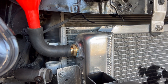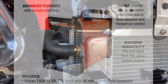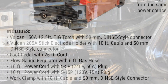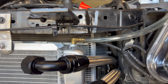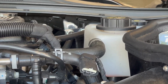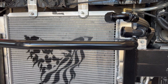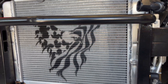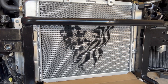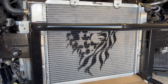It has a large three-quarter NPT inlet so that you can put AN fittings or whatever you want. It's got a vent on the top that's going to go up to my surge tank. It will tee in right there so that all the fluid coming out of the supercharger pulls any bubbles that could accumulate, making sure that 100% of this radiator is saturated.